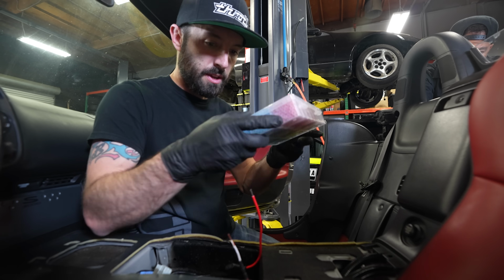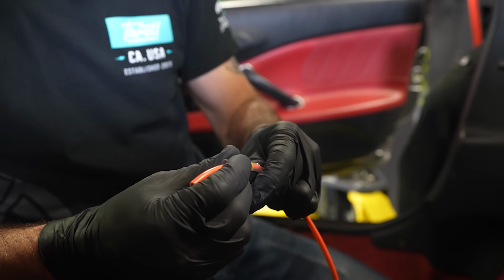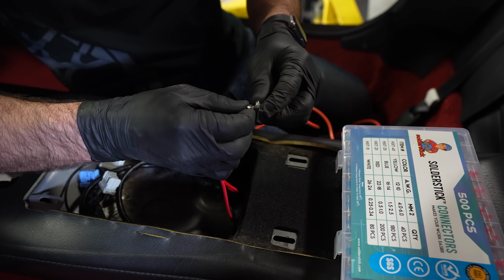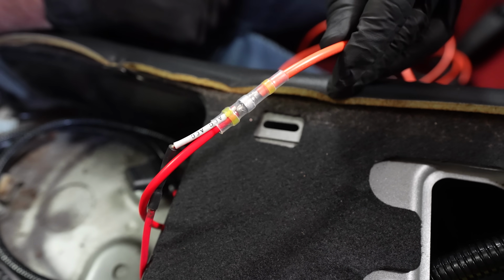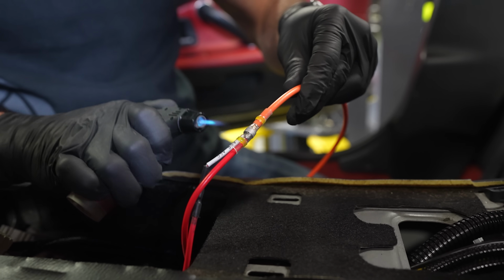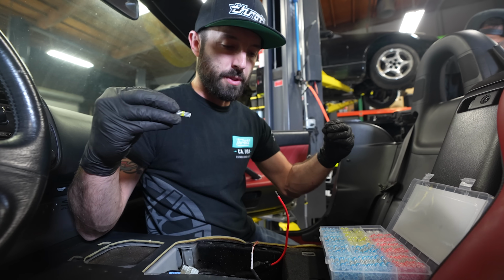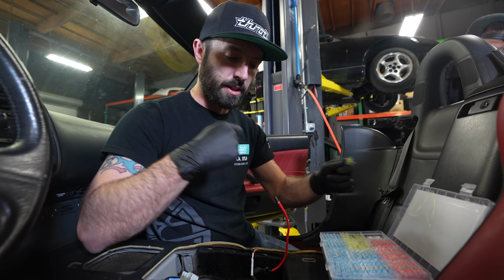And it's gonna basically be its own heat shrink and soldering just by waving a butane lighter against it. It'll melt a solder collar and kind of grip all the wires together and then melt and spread. And it will be weather tight as well. So it's a couple of different things in one. It's soldering the wires so you have a really good power connection. It's also kind of a reinforcement too, because it'll kind of hold the outsides of the solder joint. That way if it gets brittle, you can't really bend it and then snap the connection.